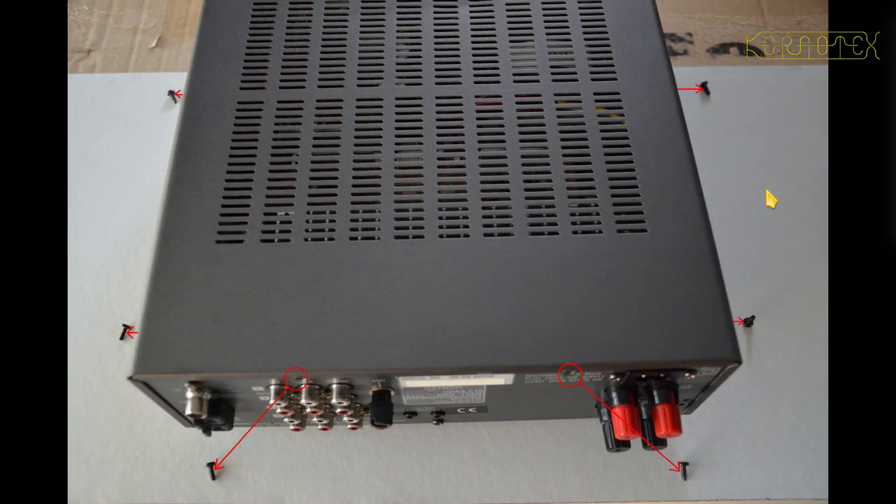The first picture is the rear view of the amplifier. The first six screws that need to be removed are two down each side and two towards the middle of the top cover lip. There are mainly two different types of screws used: shorter black ones which are metal screws with a very fine thread, screwing into metal such as the back panel and chassis.